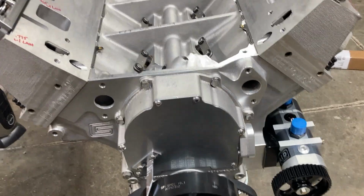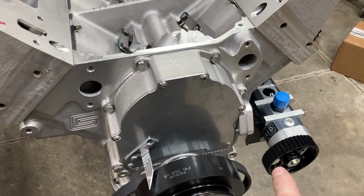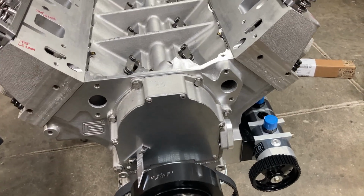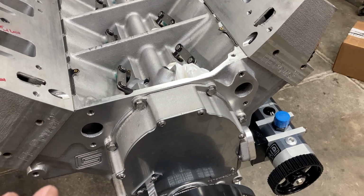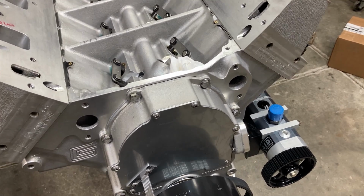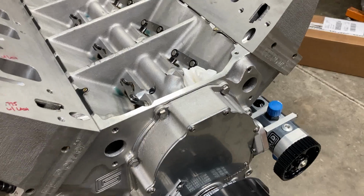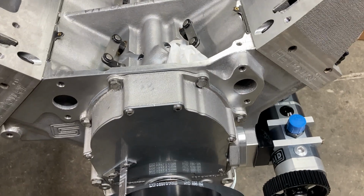So I talked to Jay, and I said, I absolutely need to prime the oil pump here, just to make sure the lifters oil, and we got oil at the top of the engine, and we got oil pressure, good oil pressure. And I said, would it be too much of an imposition if I just, at that point, unhooked everything and sent the parts in boxes, and then you could hook it up and hang it on the dyno as you see fit. And he said, yeah, that's not a problem. So that'll make things a lot easier for me as we progress. I don't have to dodge that motor plate or anything like that.